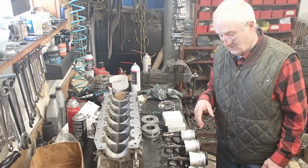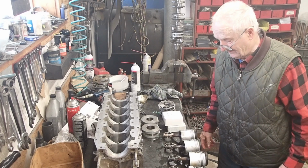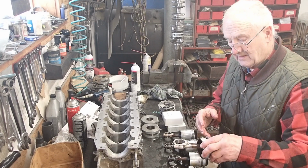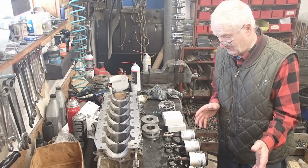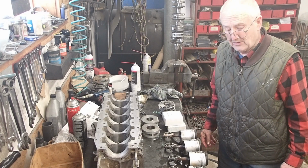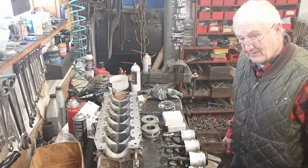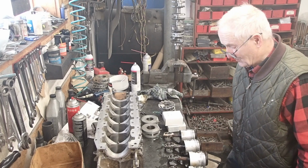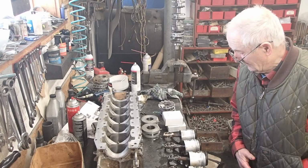They don't recommend using those because in the general course of events, people fishing, they would not stand up well. The two ringers would get worn skirts on them, that kind of thing, but they're faster. And the higher crown pistons develop more compression, and yeah, they tend to burn, pre-ignite more, but if you have your timing retarded, they stand up better and they should give me more power. I'm looking for speed out of this. So I am using used ones at the bottom two.